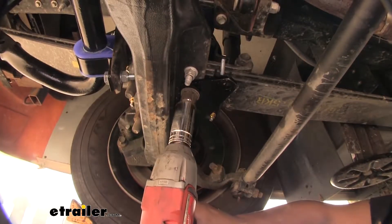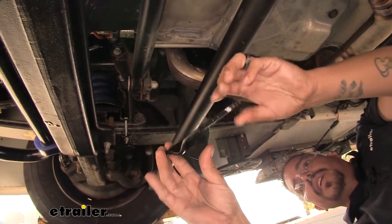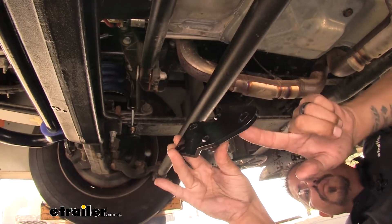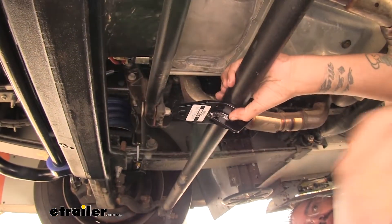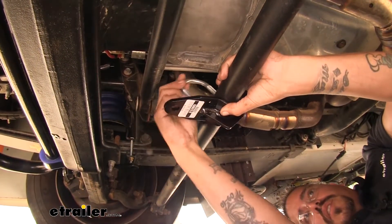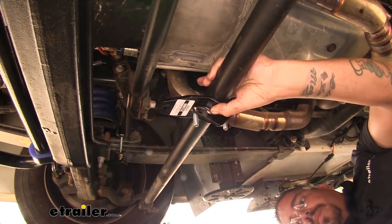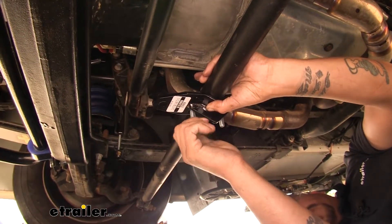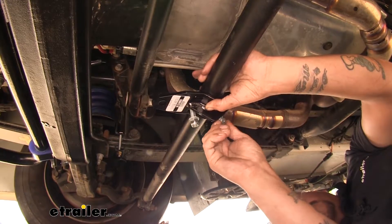You want to alternate tightening to make sure the nuts go down evenly. Now we'll grab our tie rod bracket — you can see it has a dip in it. You want that dip going against the bottom of your tie rod, with the single round hole going towards the front of the motorhome. The four slotted holes around the tie rod will take one of our U-bolts. We're going to drop it over the tie rod so it comes down through the bracket, and on each one we'll take a flat washer and a lock nut, installing them loosely because we need some movement available on the bracket.